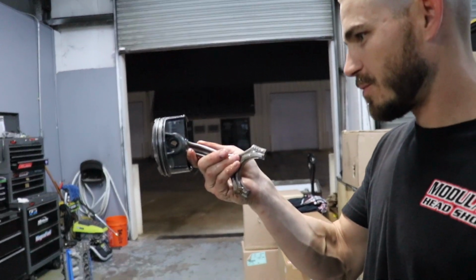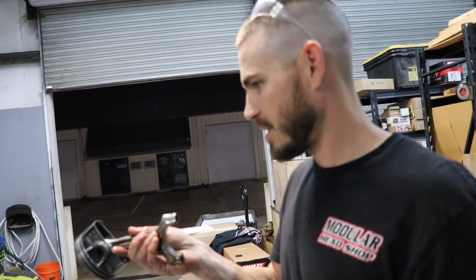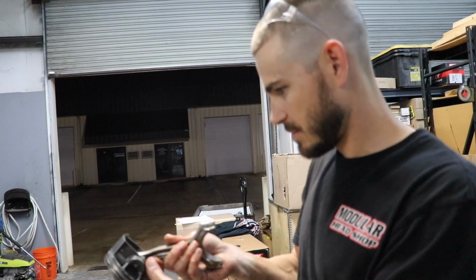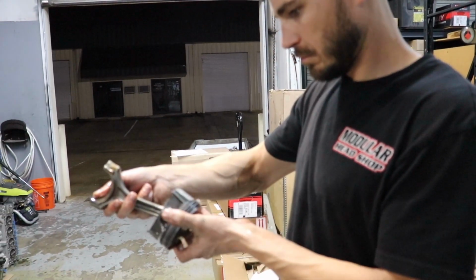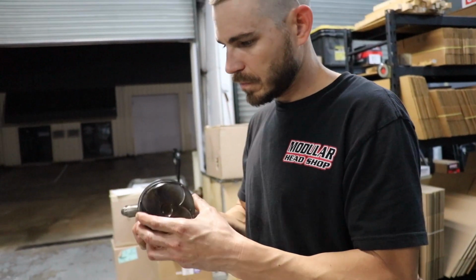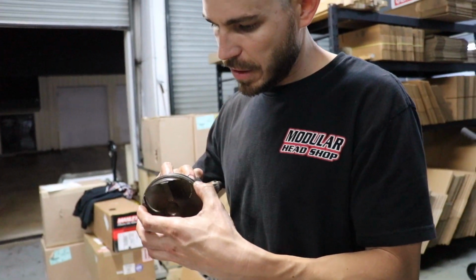Alright, so... Look at that. That's nice. I actually did a pretty good job, though. I mean, this is a nice piston. Yeah, they say the factory piston's okay. It's just a ring. I think the ringlands are having issues with the rings. I mean, the ringlands look like they're hard anodized, so that's good. I'm not really familiar with the stock pistons in these.